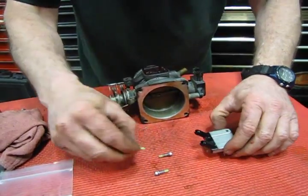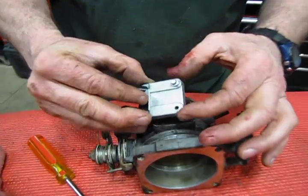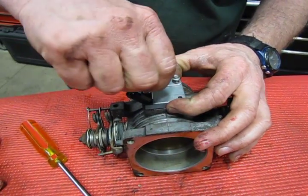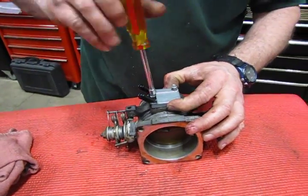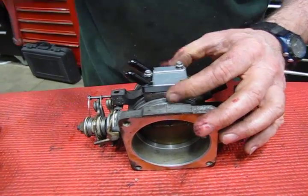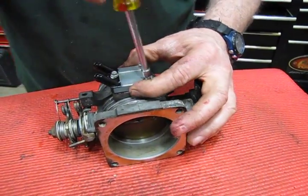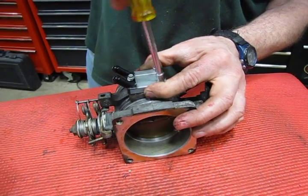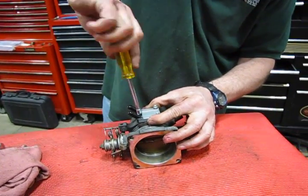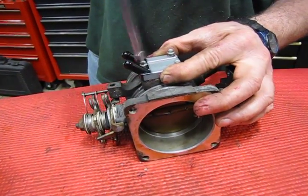Okay, so we'll set 2 of the screws in place. I like to start with the middle one and get it lined up with the hole. Again, this is a 5.5mm. Just going to run those 2 in there to help locate the 3rd hole. And we're just going to bring them down snug so you can just feel them bottom the head out.